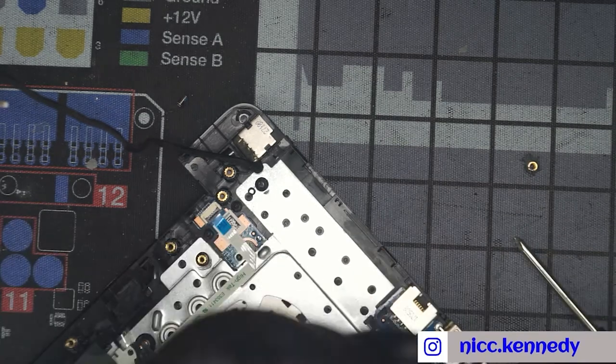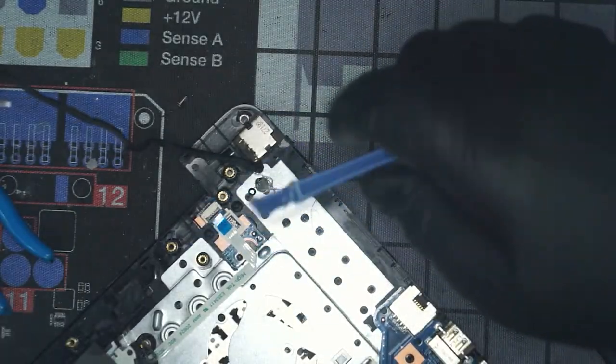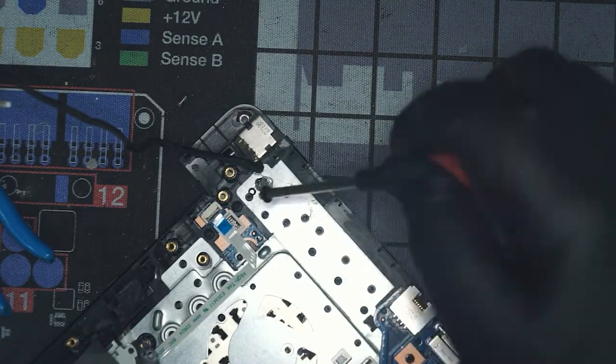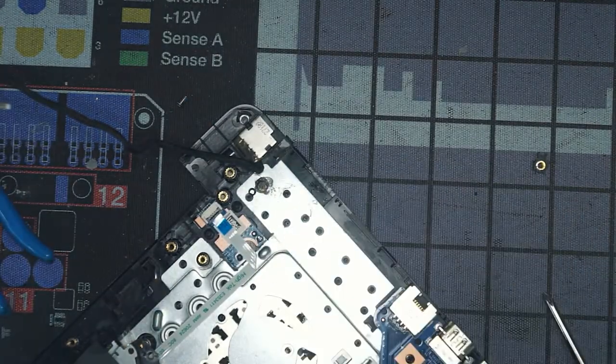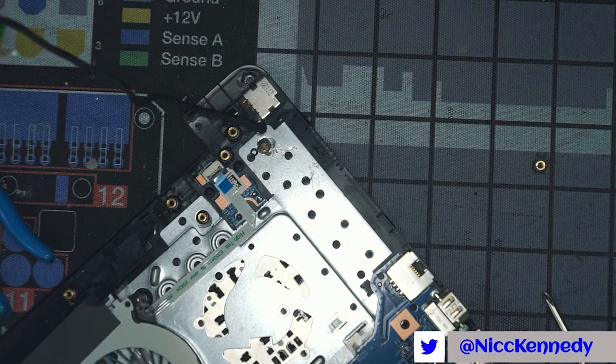I'm not super worried about that screw. We can clean it off as the epoxy hardens. As you can see, it's starting to actually set. There's that 5-minute set time. What we did do is bury that in the screw hole down in this epoxy here that is hardening. So, all right, we're going to let everything set up.